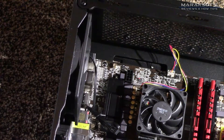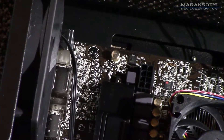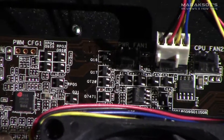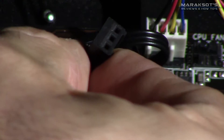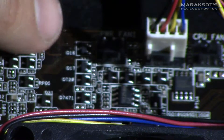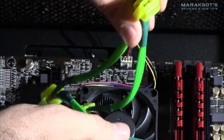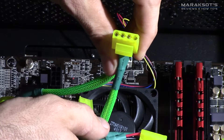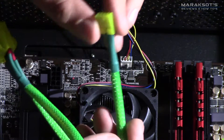Now I'm going to show how to connect your chassis fans to the different headers on your motherboard. Your motherboard is going to have several sets of pins in different locations. All you really have to do is take the fan header and plug it onto the pins, and you're good to go. There are other types of fans that do not have this style of power connector — they use an older standard, the 4-pin Molex. Depending on which type of power connector your fan has, you plug it into the corresponding connector, and your fan will work and cool your computer.